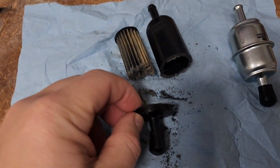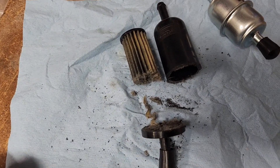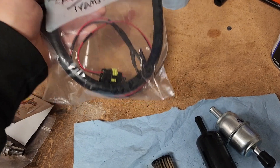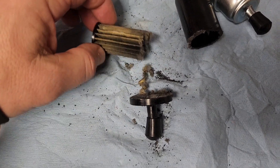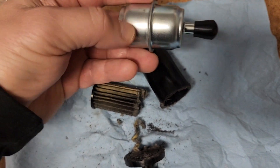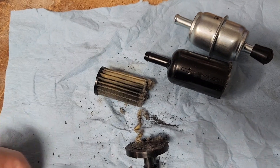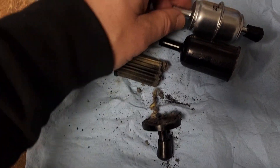Moving back over here to this filter — a worthwhile upgrade. I went ahead and put a metal one in that I got from Takamoto Co. You have to pull the fuel pump to do that, which isn't that bad really. I did use this fuel transfer tool that Takamoto Co. sells; it was easier to get the fuel out rather than trying to siphon it and get a mouthful of gas. I am not sponsored by Takamoto Co. in any way — I just wanted to say that up front. He just has cool stuff. Make sure you get the arrow — the flow of fuel — right, because these do have a direction of fuel flow. So that'd be one tip. This increases the reliability of your fuel system because you're getting something that won't burst.